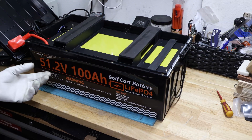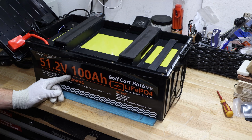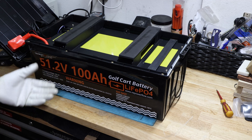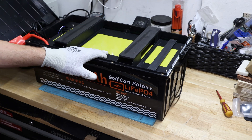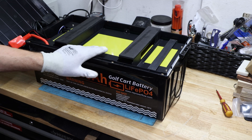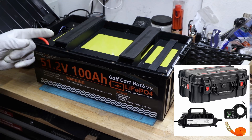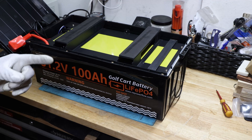I hope you enjoyed seeing this battery perform on the golf cart — it handled up to 180 to 190 amps, which is impressive. My golf cart is pretty strong going uphill with my weight. By the way, I had two lithium iron phosphate batteries in the cart compared to lead acid, which is much heavier. Build quality inside looks great overall. I do have the 36 volt Repower Flow suitcase battery I'd like to donate to someone with a 36-volt golf cart who wants to convert from lead acid — watch the video and reach out via email in the About section.